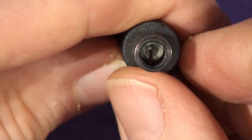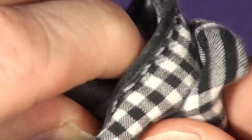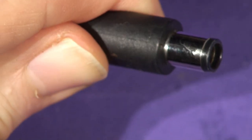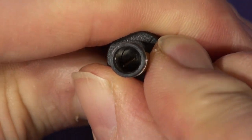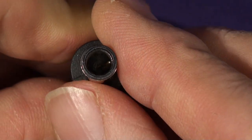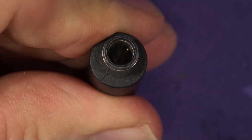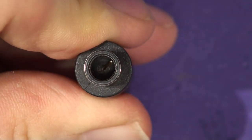If you look at the actual DC barrel connector — this is the DC barrel connector that goes in — look at the grub on this. If that's not making good connection, I'm going to use a little bit of alcohol to clean that up. You can see there was some sticky stuff on there. The main problem with this one: can you see that pin in there? That pin is the 0V rail for the power supply. If you angle it in the light you can see in there is a gold-plated pin which has been bent over to one side, and that can often get broken off or bent over.